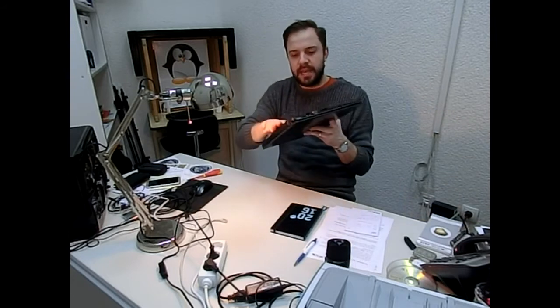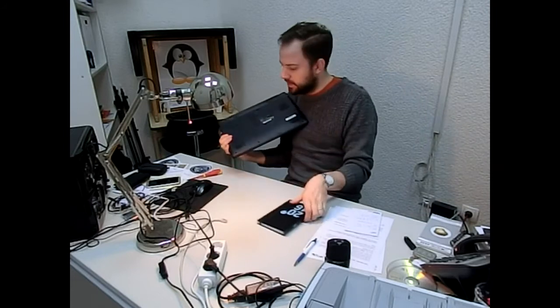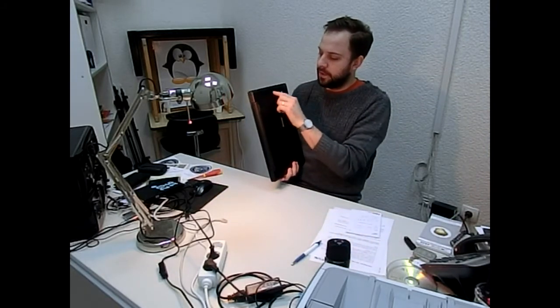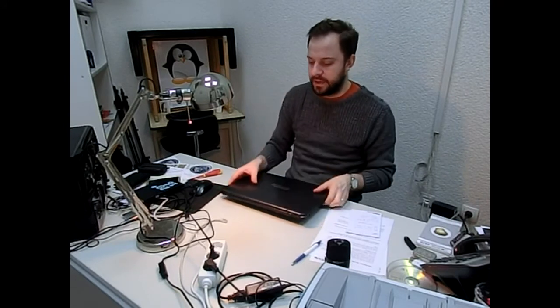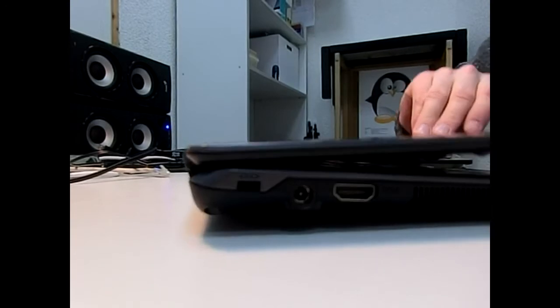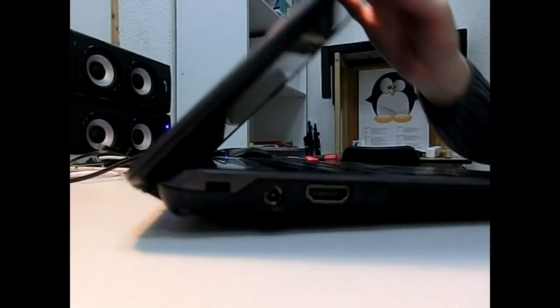So it's actually an interesting design. You have the bump in the battery, so when you put the laptop on your table, you get some additional space between the opening of the fan and the desk, so more air can flow in. And then when you open your laptop to the full, it gets raised a little bit up as well and adds some additional space.